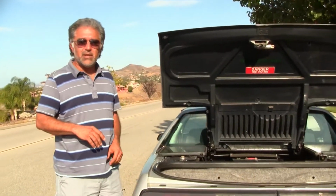It's got a gauge in there that we'll see in a minute when we go for a ride. The gauge tells you how many amp hours you're using, what the voltage of the pack is, and how many amps you're using at the same time. So instead of gasoline and gallons, you're dealing with voltage, amps, and kilowatts, and that's what's in the Tesla. You're using so many kilowatts of energy, just like your electric bill rates it in kilowatt hours. What is the maximum kilowatt hours that you can store? There's a 24 kilowatt-hour pack. Yes, because you take the voltage multiplied by the current. There's a little quick electric formula for you: kilowatts equals amps multiplied by voltage. You get the kilowatt hours.